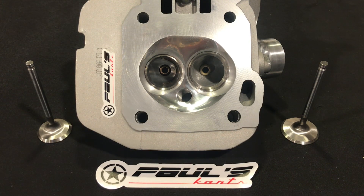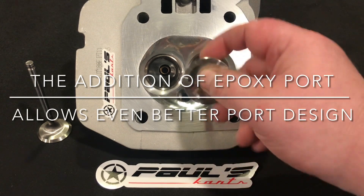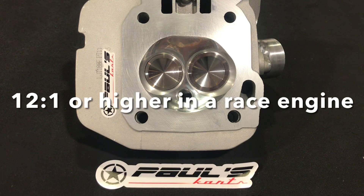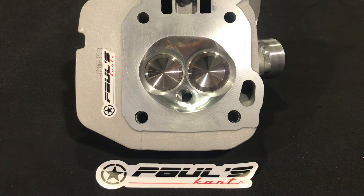It's not necessarily always about needing more CFM, but it allows you to shape the port differently than you could without a welded intake tube — to fill in low velocity areas that aren't necessary and really get an optimum port shape. We have a 38/34 — throw the valves in real quick — stainless, milled down the head a good amount to get the compression ratio up. In a big block it's really tough to get that compression ratio up. You should be chasing that 12:1 number to run your cam and get the timing events to dump the exhaust pressure fast enough to really get the engine working the way it should. It's all about trapping air.